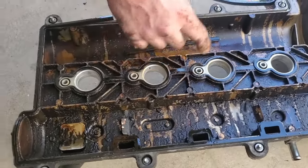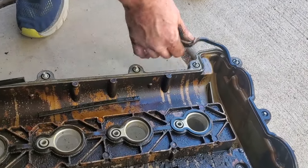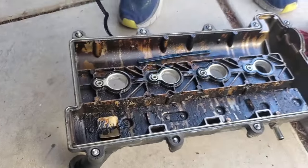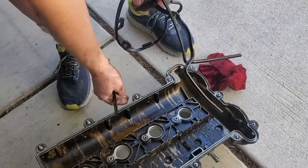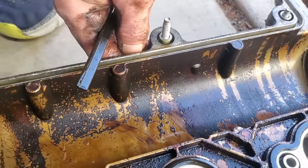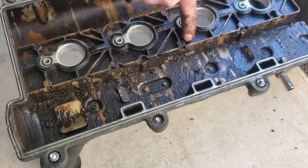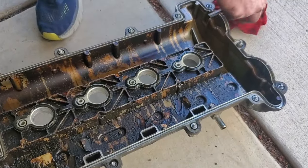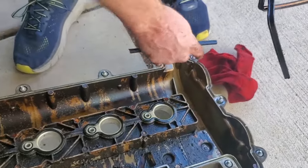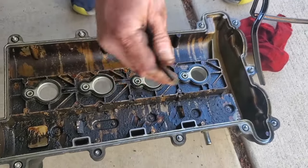Down here, this is going to take a little bit of time — I'm gonna have to pull this old gasket out and we're gonna look at possibly replacing these grommets too since they gave me new ones in the kit. There's the old gasket — this is the part that was broken and why it started leaking. You can even see right there that line, that was the crack — it was leaking right through there. And as soon as we picked it up another crack happened. This is towards the back of the engine. We're gonna clean all this gunk and crap out of here. Another reason I do my own repairs — if I bring this to a mechanic I don't know if he's gonna clean any of this out. A mechanic is on shop time; they want to get it done ASAP and get the next car in. Since it's my car I can take my time and make it as good as I possibly can.